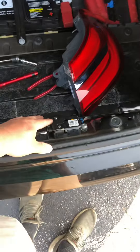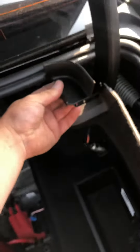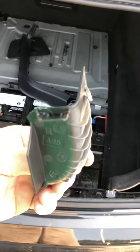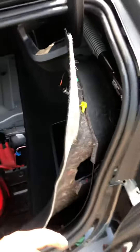I'll tell you how to do it. This front piece comes off with some push pins — that one just comes right out. The center piece has one push pin up here that goes into this tab. This corner piece goes in here like this, just snaps in. It looked more intimidating than it actually was — just pop it up and out.